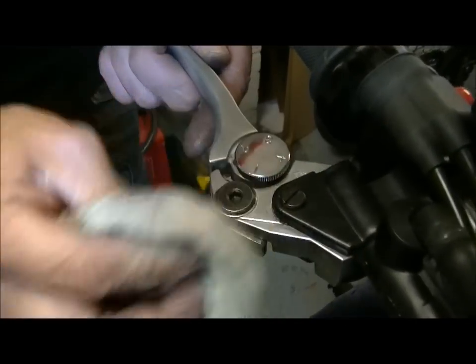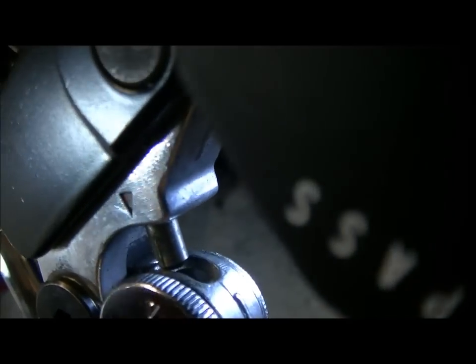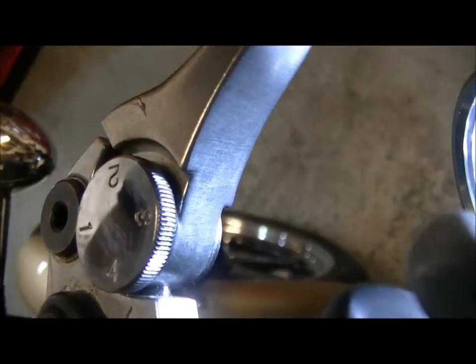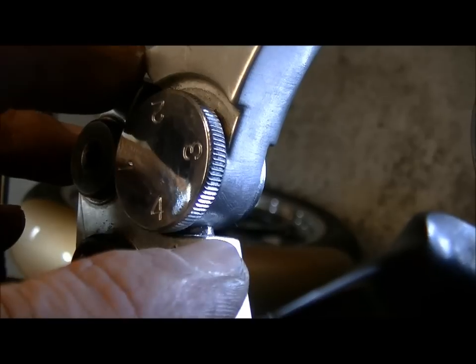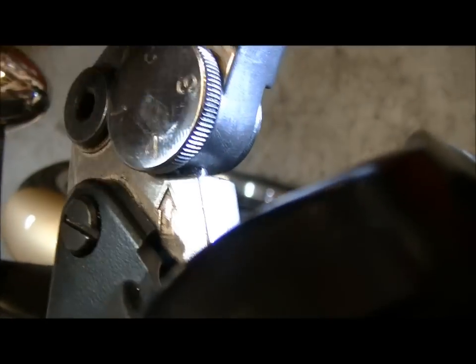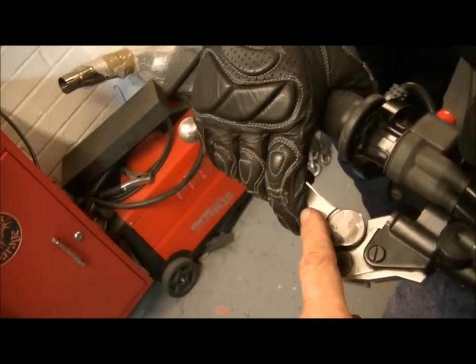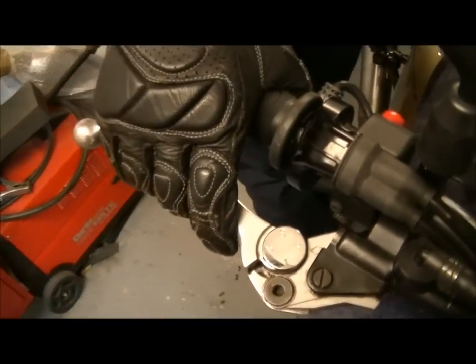Wipe off the excess. And there we are — look at that difference, how much closer is that? This is a comparison left to right: that's the one we haven't done yet, that's the peg we filed down. On number four, which is the smallest setting, it's this gap between there we're looking to reduce — and on the other side we've managed to achieve is that, now probably half if not a little bit less. Don't file it off until the body of the lever hits the body of the clamp — that's far too much, it won't work. You do need the peg to hold the cam, otherwise the cam just spins around. Pop your hand on that with a glove on — now you've got pulling here with the inside of the fingers instead of pulling with the end of your fingertips. That's a lot safer, especially with the brakes, and a lot more comfortable especially in traffic where you're on and off the levers all the time.